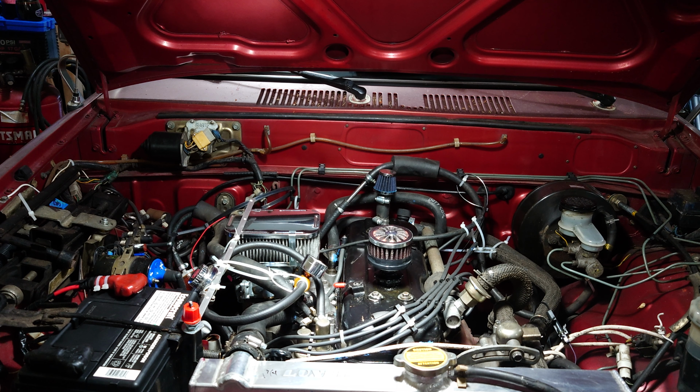And so in that case, I would just let it cool down overnight, take the valve cover back off, and re-tighten the head bolts. Give them about an extra 12 to 15 pounds of torque, you know, maybe just torque them at like 85 and see what the temperature reads when you restart it. If the temperature drops and it's running cooler, you know that you're on the right track.